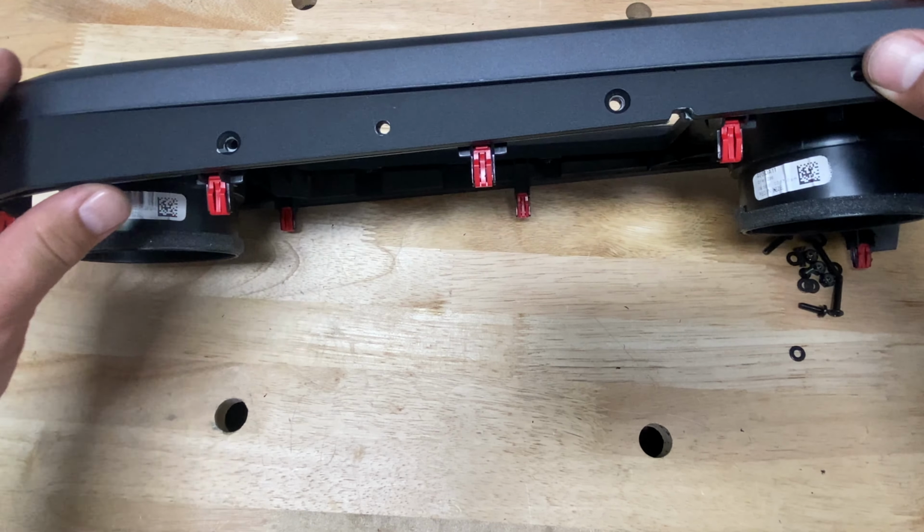This is gonna be the 12 volt coming from the cigarette lighter cable. And then next, take the stripped end of the tapping wire and insert it into the hollow end collar before screwing tightly onto the central body. And let's go ahead and repeat the same process using your black wire. We're gonna tap this into your neutral, the white, and this will complete your circuit.